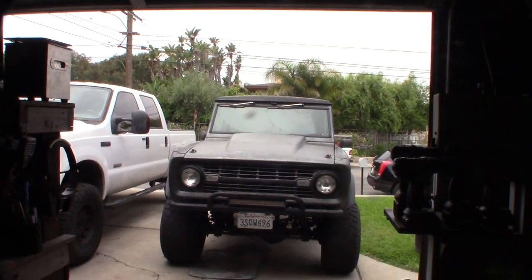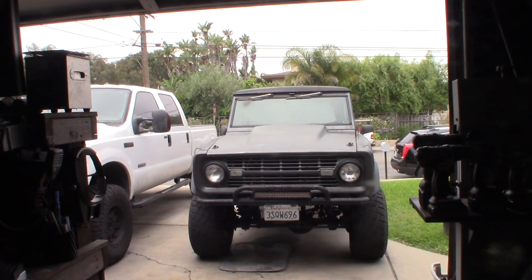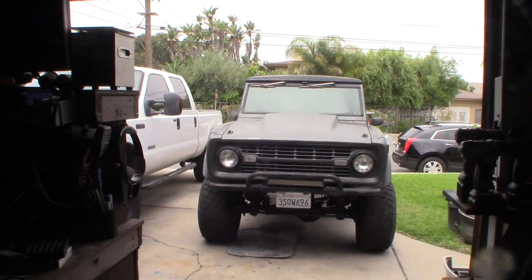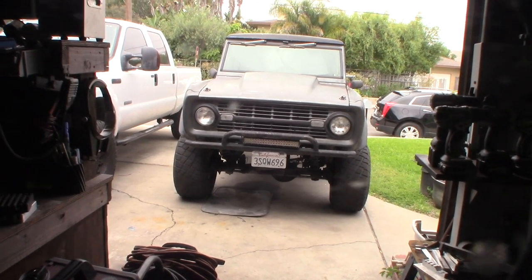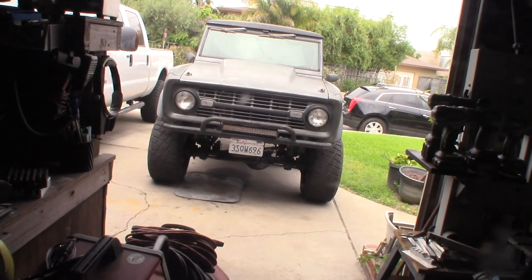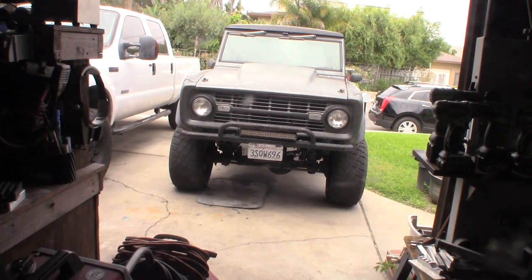About four and a half years ago I made a video of me rebuilding my driveshaft and it's starting to thump again. I felt a little bit of play in one of the u-joints. It's really just low speed thumping - it usually goes away, and that's typically what happens with a driveshaft; a lot of the issues as it spins faster will go away.